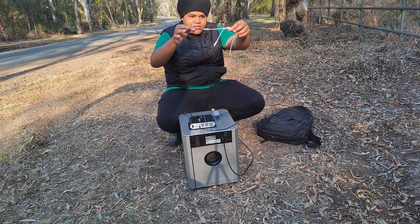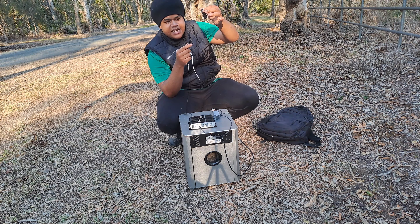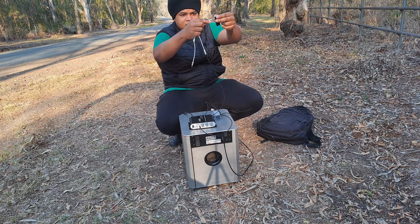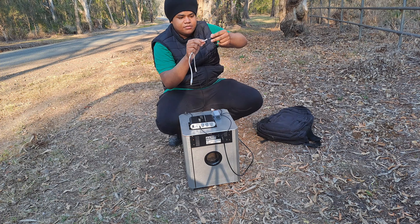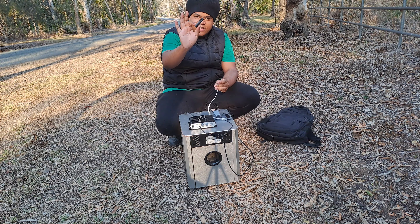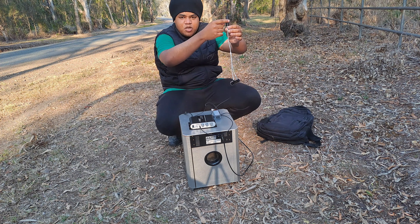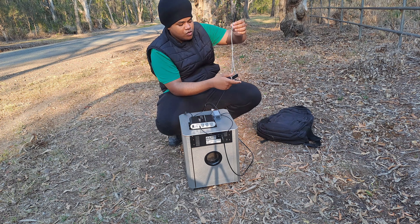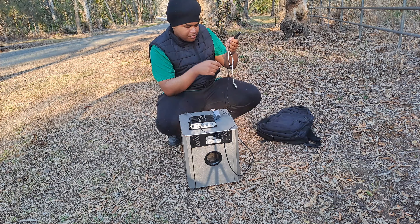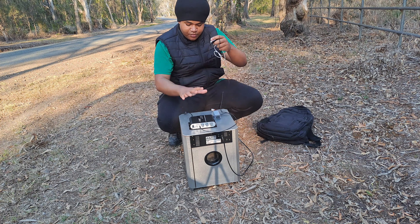Just like that. Now I'm left with this, so I'm going to separate my beast like that. I'm going to connect the FM transmitter to the female aux cable like that, and then the Bluetooth receiver will be connected like that. So the Bluetooth receiver signals will go to the FM transmitter and directly to the amplifier, and the transmitter will also allow me to transmit to the car radio.